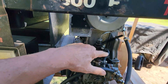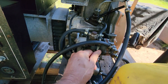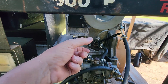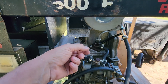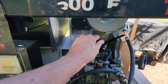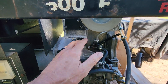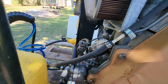I guess when it had been stored it was in the closed position and just kind of seized up from sitting. I was getting fuel up to this hose from the lift pump's primer, but nothing coming out past that. So I took it out — two bolts — and it was locked up. It's almost like a cam lifter with a spring on it. I soaked it in Marvel Mystery Oil overnight, and the next day started messing with it and it finally popped loose. I was able to get it working and put it back in, and it cranked right up and ran fine.